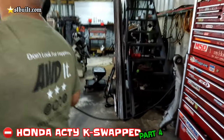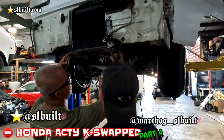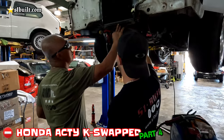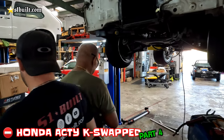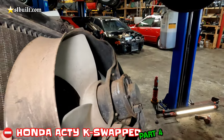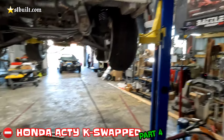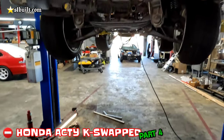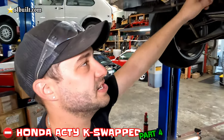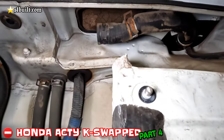We're looking at the other radiator over there to see if it could go here. We could modify it — the width is the main concern, not the height. Let me grab it and take this radiator out. Wow, that thing is thin! Today we removed it to figure out the dimensions and try to get a thicker core radiator. This radiator is kind of interesting — this is the bottom coolant line, this would be the top, and you actually fill it on the inside of the car. There's a cap on the inside — hard line goes back to the motor. We're going to see if we can utilize these lines again.